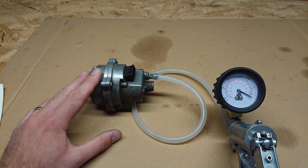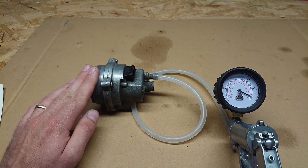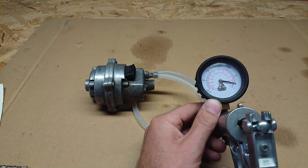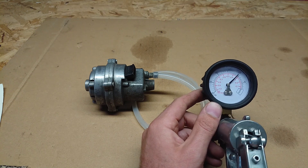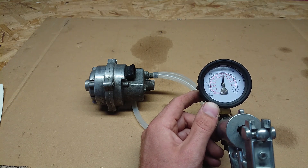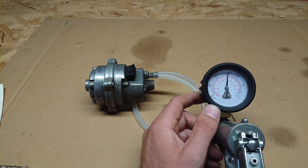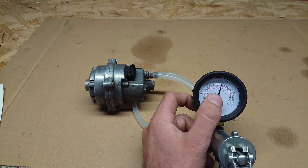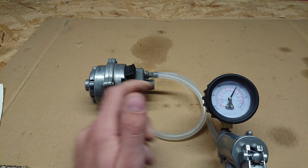This particular unit, if I remember correctly, takes less than 10 seconds — but it's pretty close. The car does actually run with this and runs pretty well; however, it doesn't run as well as it should. Carefully pump up the vacuum — you can hear the diaphragm moving in there. That is negative 0.5 bar: one, two, three, four, five. So that's only five seconds for it to drop to 0.45 bar. This is definitely a fail.